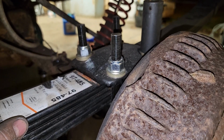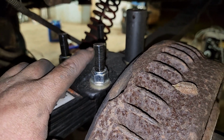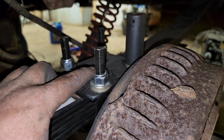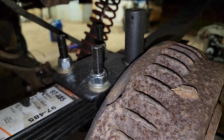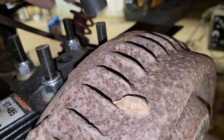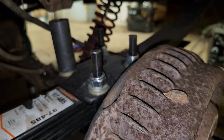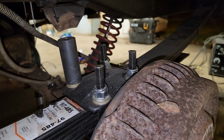7.5 still would be kind of short. Because this has about 1.5 inches left up here, I can still put an inch block on here just to lift it up an inch if I want, and the nut would still torque down barely, but there would be enough. But anyway, lesson learned: stock height, stick with the 7.5-inch U-bolts, don't get the 9.5-inch. So, anyway, everything is all bolted up, it all lined up perfectly.